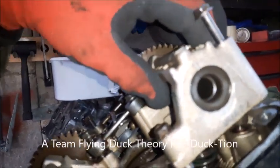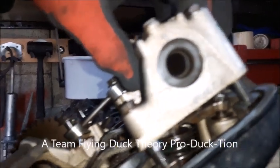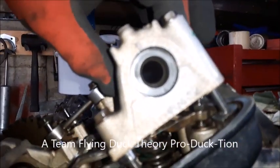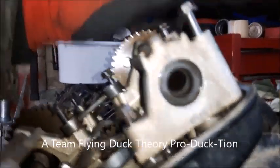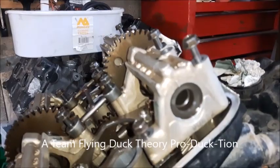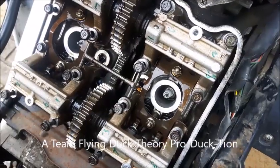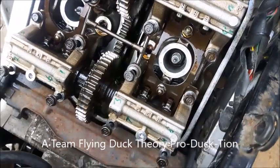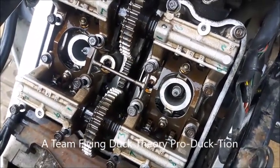Under the bolts, as I have done there, literally just lift it up, spin it around 180 degrees so it reaches the mark, put it back down, do the bolts up — and it really is as simple as that. If you look closely at the camshaft holders, I've numbered them so that I know what order to do the bolts up when we come back to torquing them all down again.